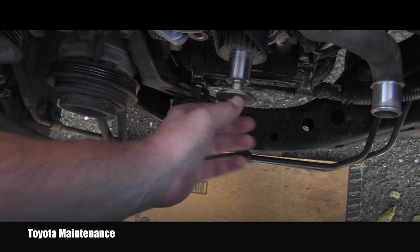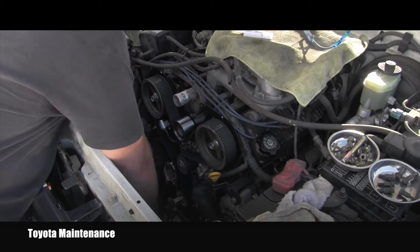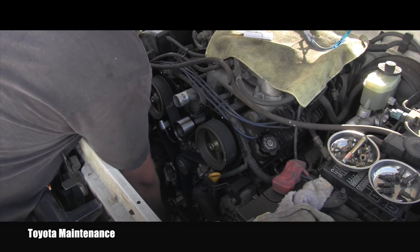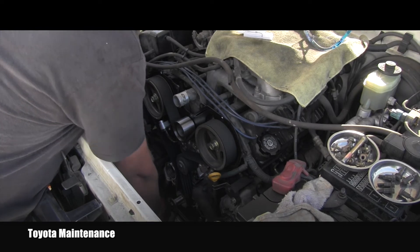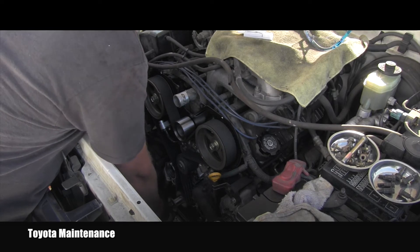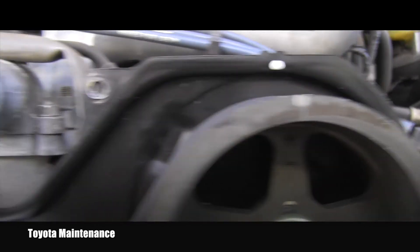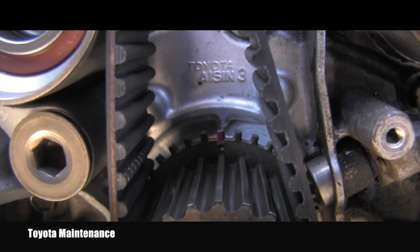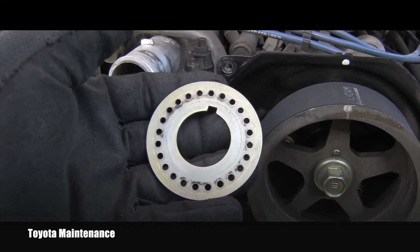It's time to remove those pins and check the entire timing. To check the timing, you rotate the engine — and you always rotate it only clockwise. I temporarily install this bolt, and as I said, only clockwise. I rotate the engine, observe the timing belt nicely in position, and observe all the timing marks after moving it all the way around. I can see the marks are matching on both top pulleys and also matching down on the crankshaft pulley and oil pump cover. My timing is perfect.